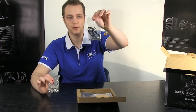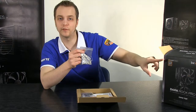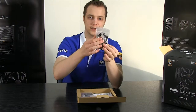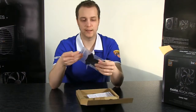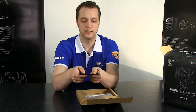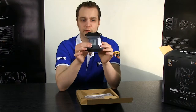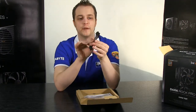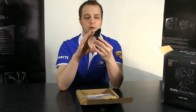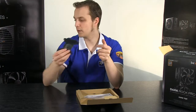We've also got a second mounting kit, which I'm guessing is for the addition of socket 2011 - looking at the front of the box, that sticker was clearly an afterthought. Socket 2011 came out, they made a bracket to adapt the cooler to it and included it. We've also got the backing plate, which helps spread the weight. It's pre-insulated - covered in plastic with a foam layer - so you don't have to worry about shorting anything on the back of the board. It distributes the weight evenly on the back of the board so the cooler isn't pulling on the top of your socket.